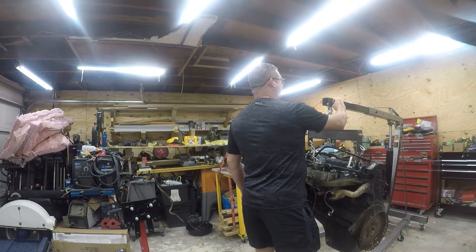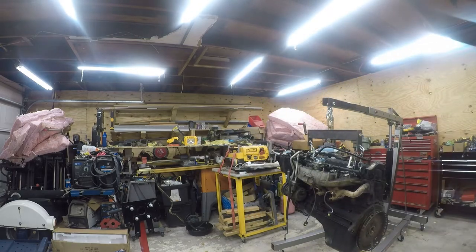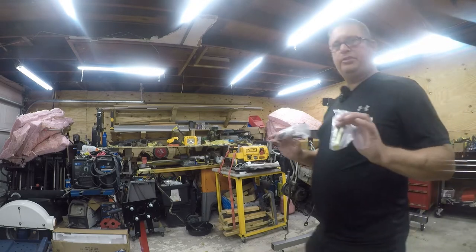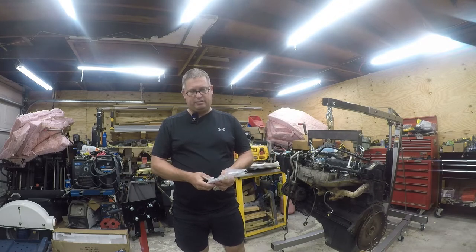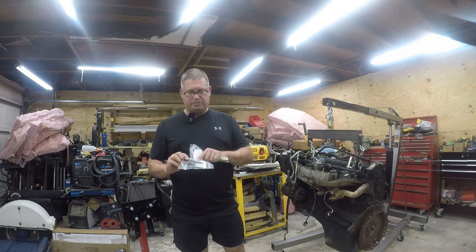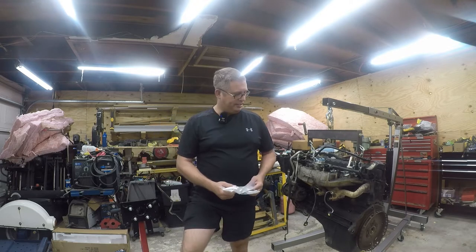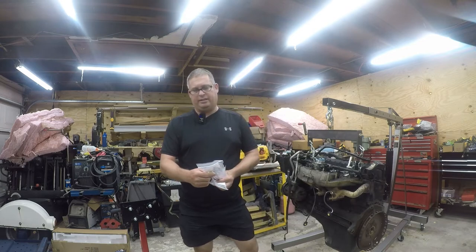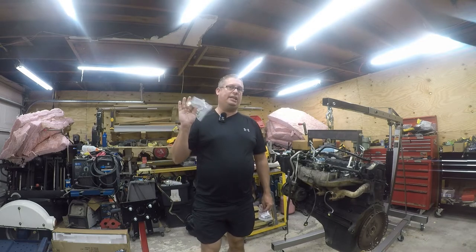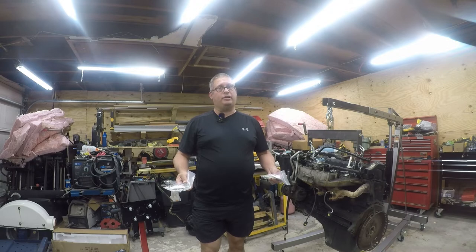I mean, it really will just spin on here. All right, so that won't come off. So there are two different sizes of bolts that you need to put this engine on an engine stand. You need some 3/8 bolts with 16 thread pitch, which means there's 16 grooves per inch, that are 4 inches long. That's what online says. And those go up here. And for the lower ones, you need 7/16 by 14 thread pitch, 5 inches. And these, it could be 4.5, but the length doesn't matter because it'll just thread through there. So that's what we're starting with.